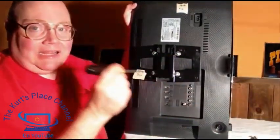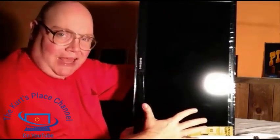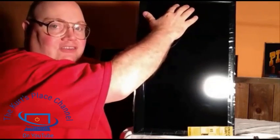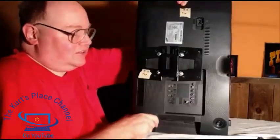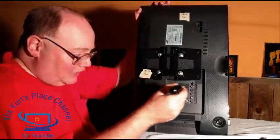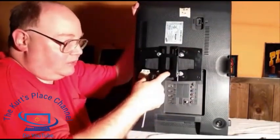I'm mounting the monitor up and down, not left to right, because when I play vertical games like Pac-Man, Ms. Pac-Man, and Q-Bert, I like to have the full screen just like the original arcade machine. You can also mount the bracket the other way — just keep in mind if you mount it that way, make sure the bracket in the back clears any cables going in. I had a situation where a bracket was blocking connections and I had to modify it. Always make sure everything is clearing behind here so you can access all your cables and power supply without the bracket being in the way.